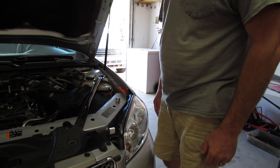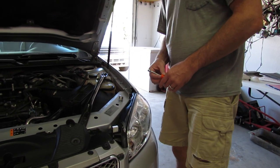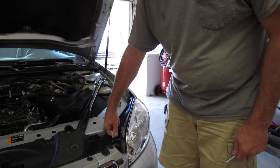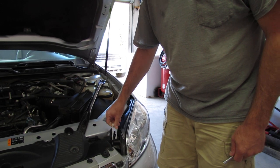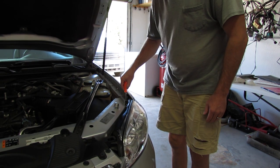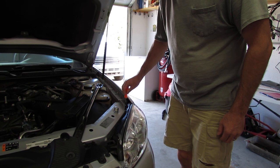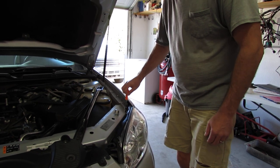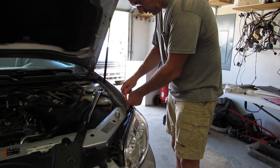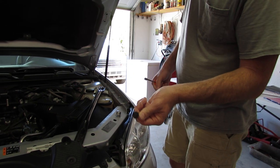It's a 2013 Chevy Impala. I'm taking out the headlight. First thing is right here — it's a plastic piece. Just got to pull up and then it just comes out. Then over here, on top of the side, it's a 7mm little screw.